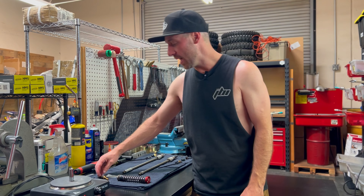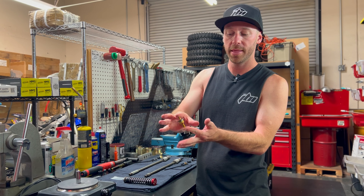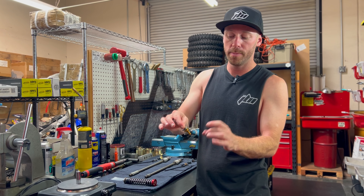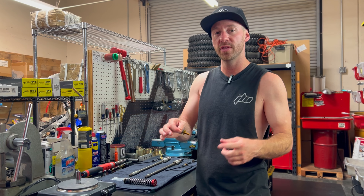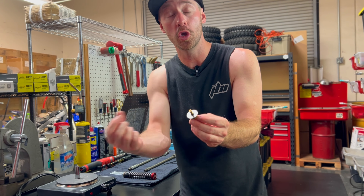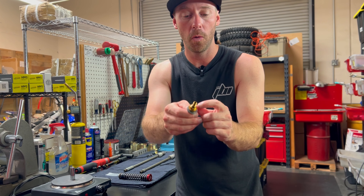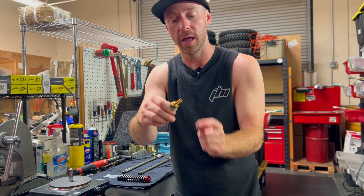The first item you're going to get from us is a complete JBI titanium sub-valve, complete with all the shims already on it. The shims we provide are custom selected and built based on the information you give us. There will be an o-ring on top — this o-ring is not going to be used; it's here to keep the shims in place during shipping. The o-ring on the back side just above the threads does stay in place.